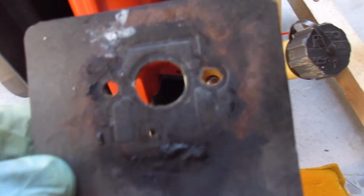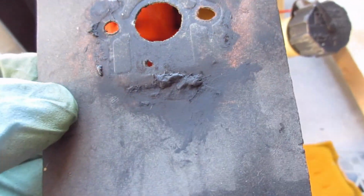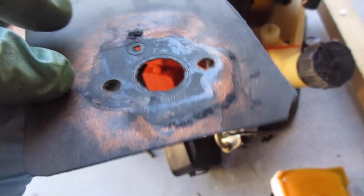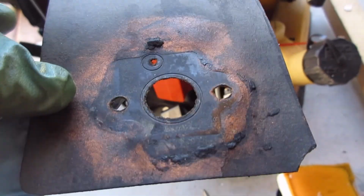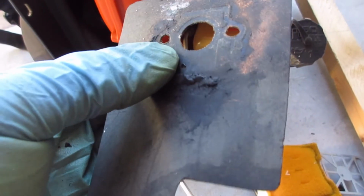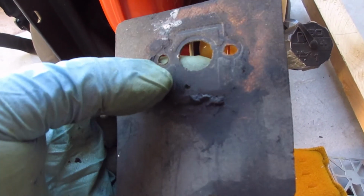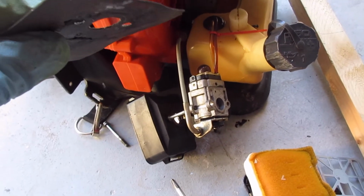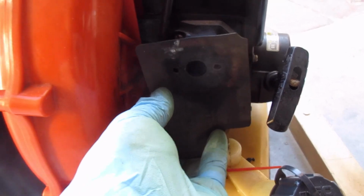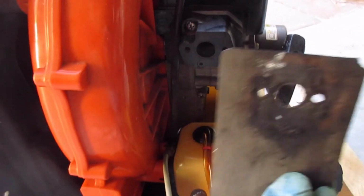This is a gasket I made. I know, I'm making them better and better. I don't know what happens to these though, but it starts leaking around this edge over here, and I tried to put gasket sealer, but it's not helping. I think this paper doesn't squish enough. This is some Felpro gasket paper. It probably would work. They do make gaskets about this size too, small ones. I don't know why the factory did it like that. I just always duplicate it.